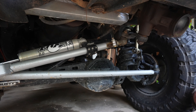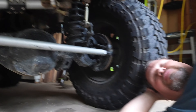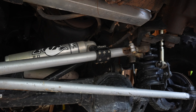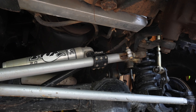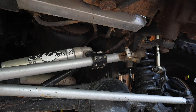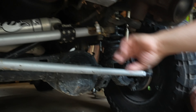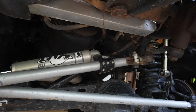The steering stabilizer piece is right there. I wish mine had a little bit more presentable look, but it's tucked up under there and it's not a show jeep so I really don't care. We've spun the steering stabilizer up tight out of the way. There's no modification needed to the spindles with this — you literally just bolt it boom boom boom. I believe Synergy sells the stabilizer bracket by itself.